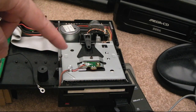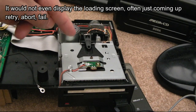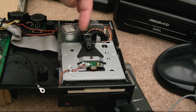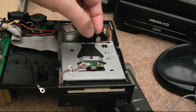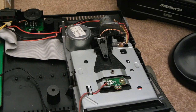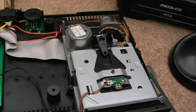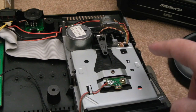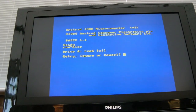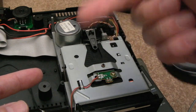When your postman delivers your post through your letterbox with elastic bands wrapped around it, keep them — you can use them to fix these drives. The other thing is Robocop. I could not get my Robocop disc working with my CPC. As I mentioned in that Spectrum Plus 3 repair, I thought I'd try cleaning it the same way I cleaned that Plus 3 disc. You start reading the disc — run disc or cat. Use the opposite side of the disc you want to clean. This disc currently doesn't work on this CPC. If I type run disc, you can see it has a go but it's not finding anything — the LED is flashing and it's come up with retry, ignore, cancel.